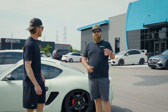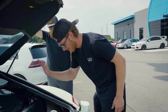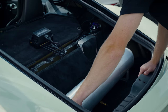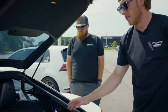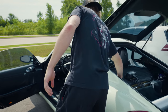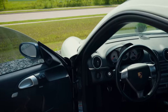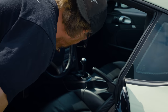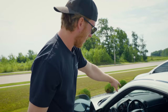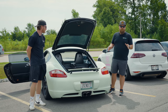Coming around to the back of the car, we've got a mock-up setup. Nothing's hard mounted yet, but the tank is positioned far enough for access to the oil fill. The compressor is hidden away tucked in the corner, nice and neat. All the lines ran up through the underbody through a grommet and along the firewall by the motor. The wiring harness starts back here running power to everything — it comes up over the strut perch, down the carpet, tucked through the interior, up past the fuse box, under the dash, and then through a grommet into the front with the battery. The controller comes through and is tucked up with the harness over the fuse box, up over the pedals, and out through the center console — eventually to be mounted on a vent. The setup turned out really nice, especially with the compressor off in the corner keeping things quiet.